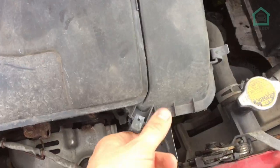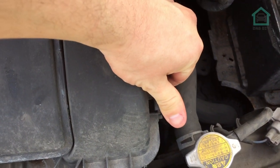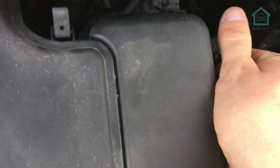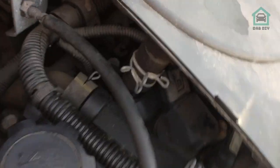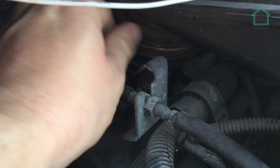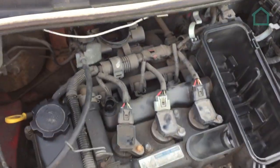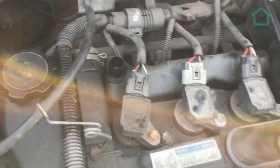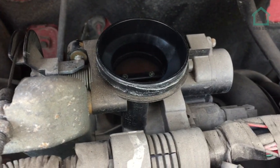The first thing we want to do is remove the air box. To do that there's a handful of clips — around four of them. Of course you can get them off with one hand because I can't. Those four clips — we move around to this side, there's one little squeeze here, you pull that up, and then another little squeeze there and pull that up.